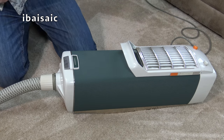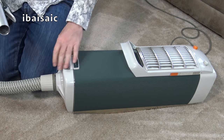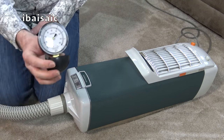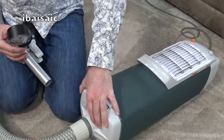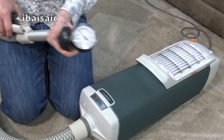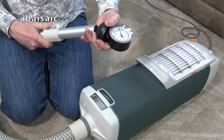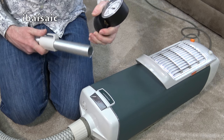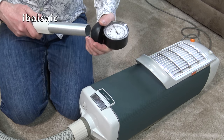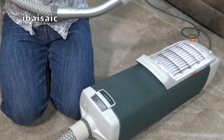Some vacuums do work very well on this plush carpeting, but I have found that they tend to be the exception rather than the rule. I can't buy another carpet now, can I? Fortunately the rest of my house does have much lower pile carpet that I can use this cleaner on. I've got my suction gauge just out of interest - we'll see what the suction power is at the handle end. Don't forget, this is a 550-watt motor. We'll see how effective this is at converting electrical wattage into air watts, or suction power. Really a decent figure - anything over 80 for a straight suction cleaner. If this gets anywhere near 80 for a 550-watt motor, it's doing very well.